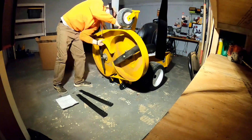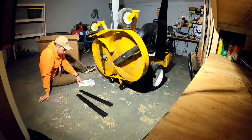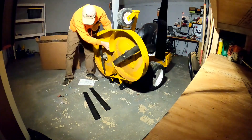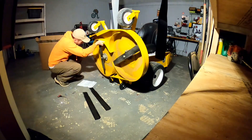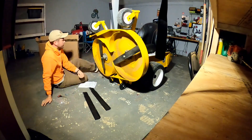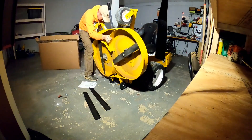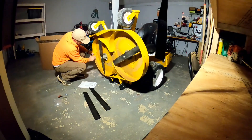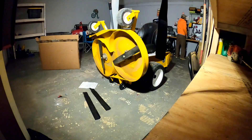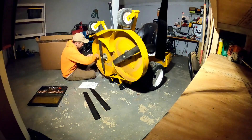It's a great addition to your Walker R21. As you can see on the side of the deck, I ended up mounting this up and you see that little lip on the mulch kit baffle. At first I had it on the inside, just not knowing how it went. That little lip needs to go on the outside. You can see I'm kind of wrestling with it trying to get it to fit - that's one reason it was tight and hard at first. It bolts in like three or four different places.